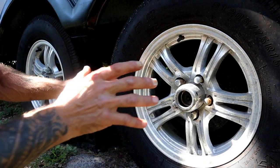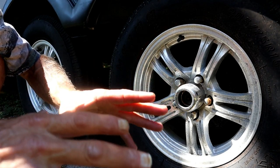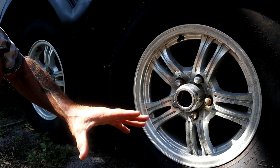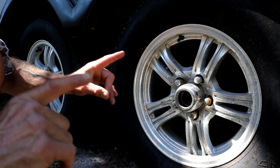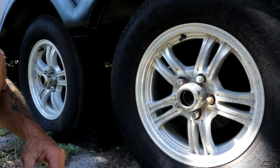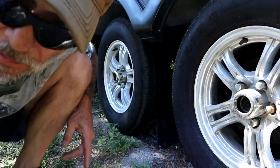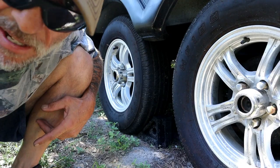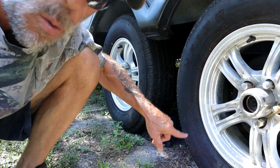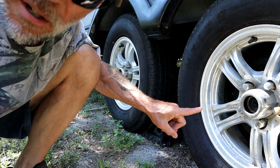We're at the tires and rims. If you're a traveler and going to be on the road, these tires need to be up to date. On your tire there's usually a code — for example, '3211' tells me these tires were made in 2011. So before I get down the road with these, I need to update these tires. I don't want to be loaded down heading to Colorado and have a blowout on the side of the road. Keep up to date on your tires — big thing.